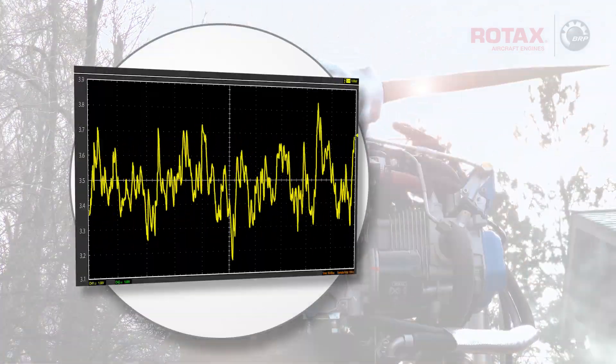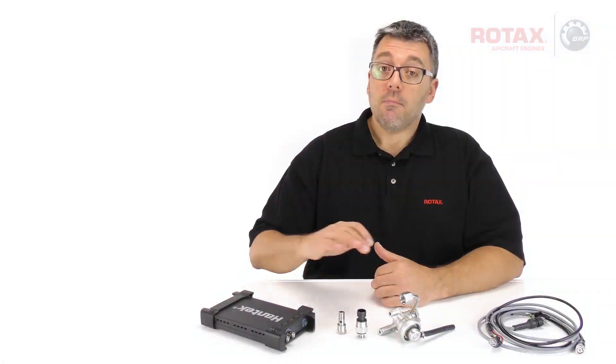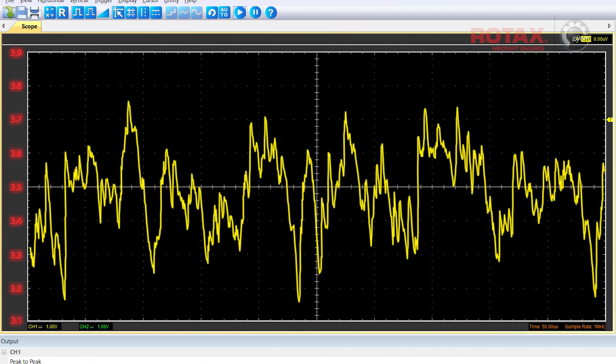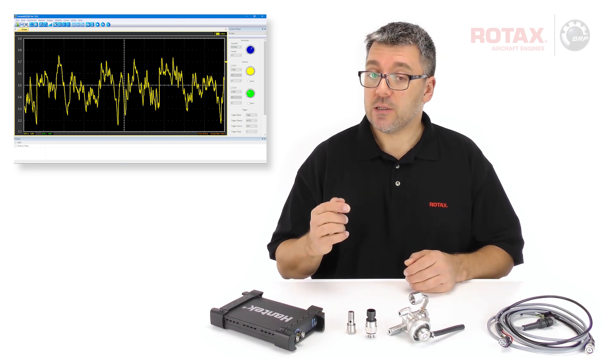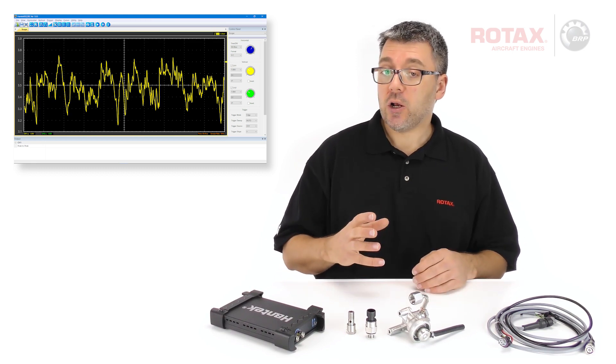Take a snapshot on the oscilloscope and shut down the engine. On my budget USB scope, the graph displays absolute fuel pressure on the left, and I've zoomed in to see individual oscillations. In yellow here is fuel pressure moving up and down very quickly. An analog pressure gauge doesn't react fast enough to effectively see this, but a digital reading does. A tiny spike here can trigger engine monitoring units, or EMUs, to display a fuel pressure error.